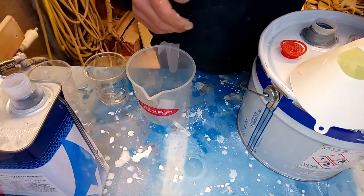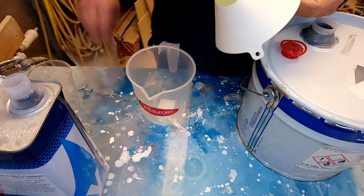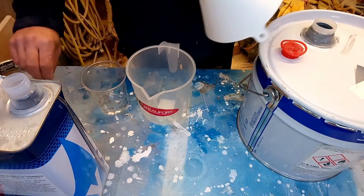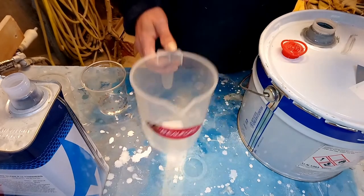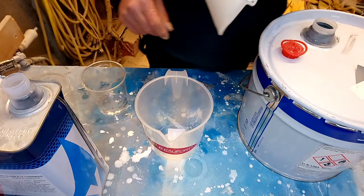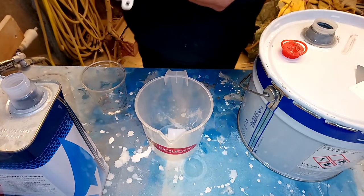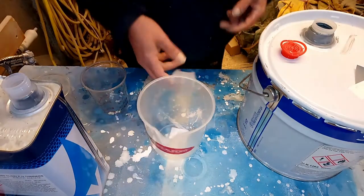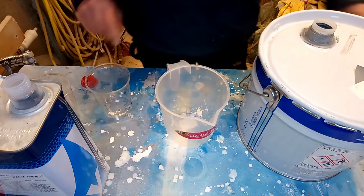Right, time for some grey. New filter, new mixing cup, new waste bin. Big tin, so I'm going to pour some in this jug. I've washed it out with soapy water and given it a wipe down with some thinners. Really don't want oil, water, silicone, that's the worst one. Put that there. I don't think I can pour this big tin into this little cup, so...